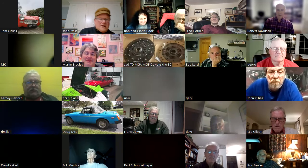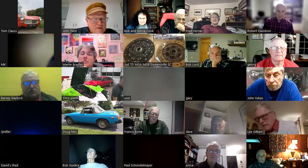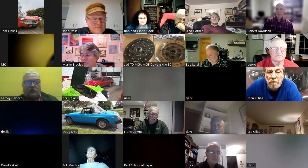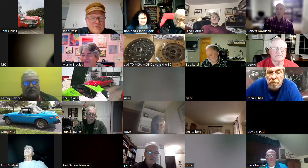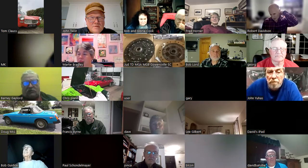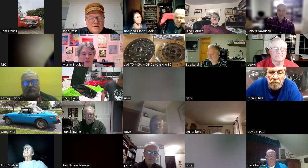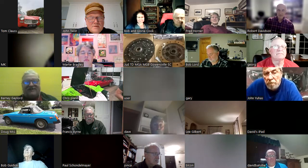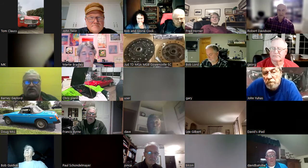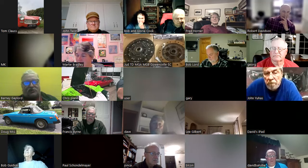Hey, John. Yeah. So I'd like to add another comment about clutches and how they work. I got some information on competition clutch conversion. Should be real brief, I hope. All through the 90s, I was autocrossing with SCCA. At that time, I ended up putting an MGB clutch in the car because I had an oil leak that messed up my clutch and it slipped, and I thought that might help. Turns out it didn't make any difference. If you got oil on your clutch, it's going to slip anyway. When this was slipping, I put a competition pressure plate in there, and that didn't help either. It was still slipping from the oil.